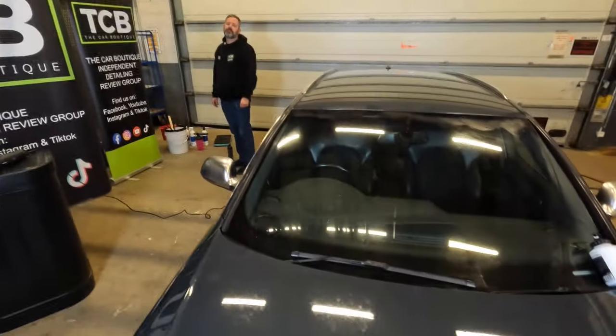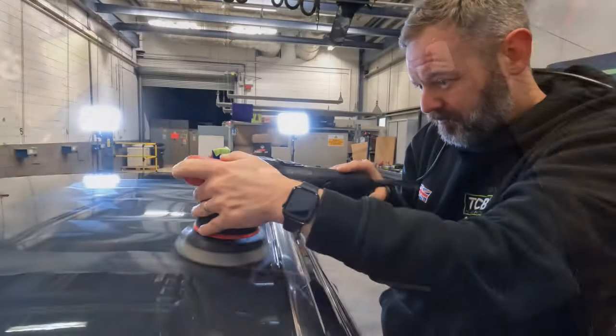So my personal opinion, the medium compound and the medium cleanser fluid work well together. They're not the most aggressive medium, but for a car like this where we're not chasing perfection, it's absolutely great. And certainly if you've got a nice car that isn't in too bad condition, this has got finesse to it, this compound. Still got to do that side. That is looking great. So I'm really, really happy. It's first time using these polishing pads and compounds. So really, really pleased with that. So Carl's ready. He's saying, get on with it. We have got the rest of this car to polish. So exciting times.